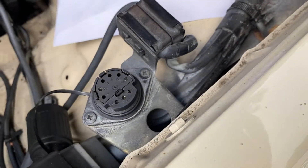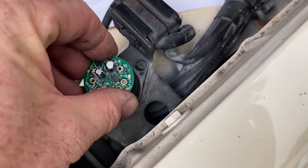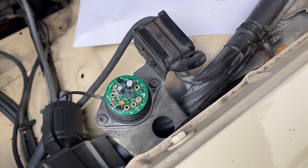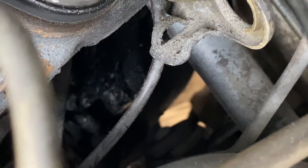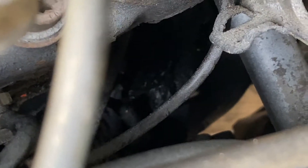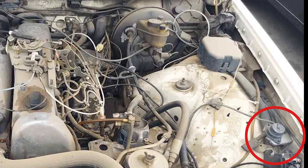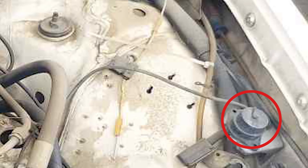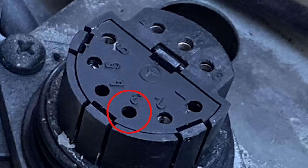On the later cars they don't actually use the tach amp at that port — there's just a little cap there, and it's just a port for the technician to plug diagnostic tools into. But on my car someone had an amp plugged into it when I bought it, so I just assumed this was the earlier setup. Sure enough, if you look down in the filthy recesses on the back of the engine there's a sensor line coming out. All the cars have this port in the engine bay and they all connect to an RPM sensor in the front of the engine. If you look closely at the connector in some of the earlier clips, you can actually see very clearly that there's no receptacle for pin 3 — it's just a dark hole.